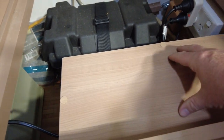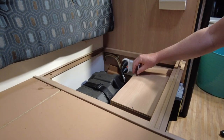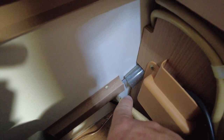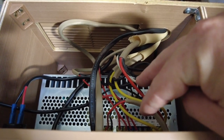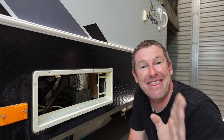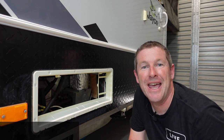In our Swan, to get access to the cabling on the CTEK unit you remove two tabs which expose Phillips head screws that remove the cover panel. The plan is to pull our cabling in from a little opening down the bottom that runs through to our fridge, follow the main cabling conduits up, and then terminate our positive and negative into one of the spare terminals on the back of the CTEK unit. From outside the van, that cabling comes out just down the bottom, so it's a case of removing the lower vent and using that same hole to feed our wiring back through.